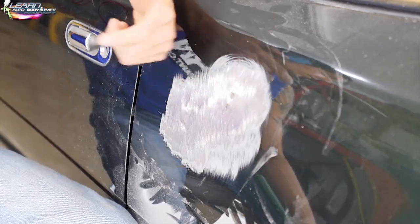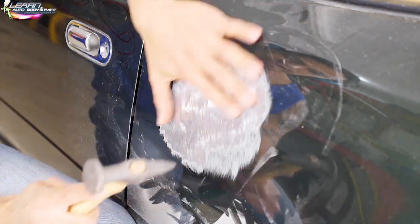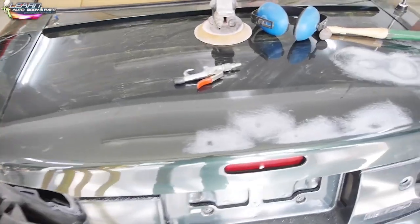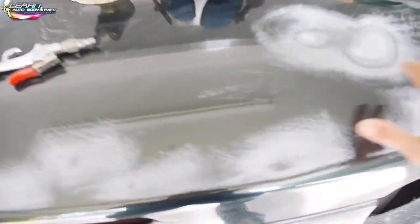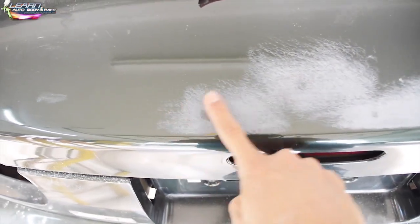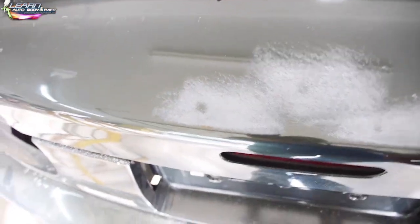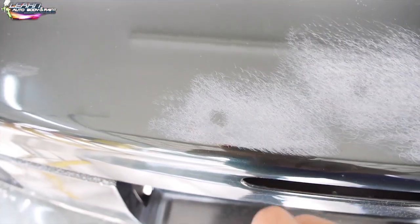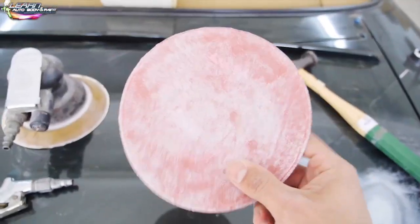So if you see a metal spot coming through to your bondo, you just want to hit the spot down a little bit. But other than that, I showed you how I used the 80 grit DA and I sanded. Now what you see here are all the low spots — all these dark areas here are basically unsanded paint.